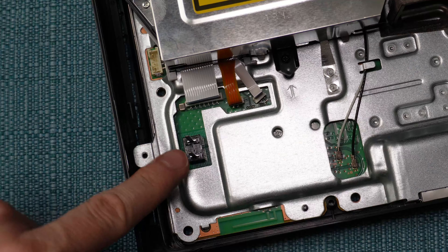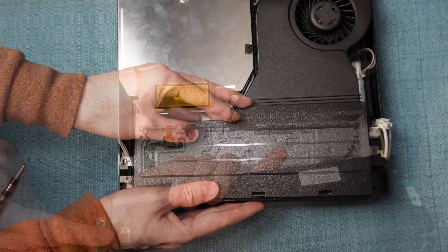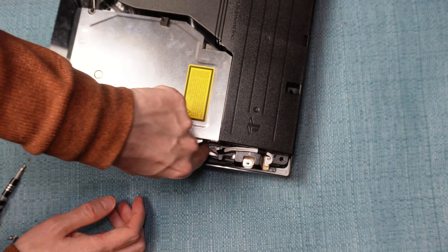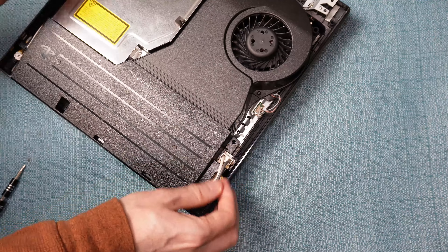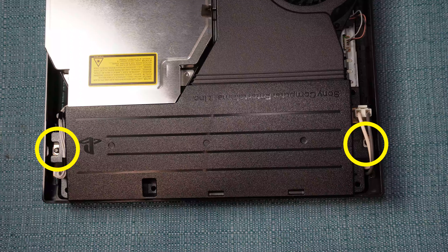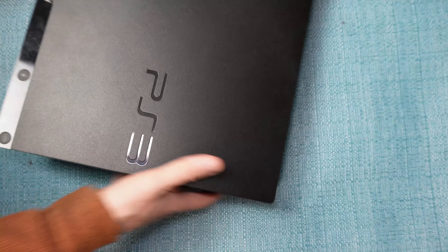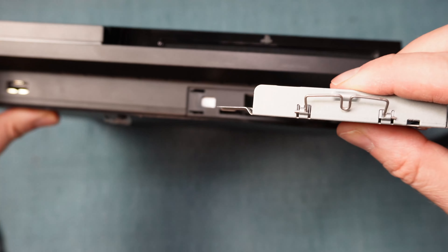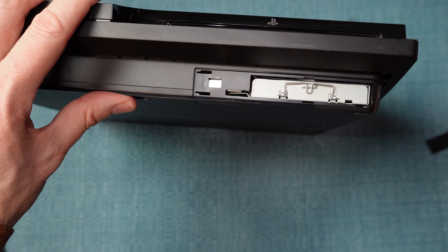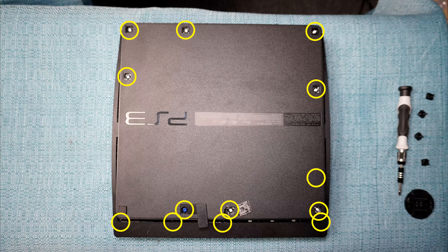Next put the power supply back on. You don't want to bend those pins, so just make sure they're lined up with the two holes. Reconnect the ribbon cable here, then the big one on the other side, and then the small one over here. Screw the two power supply screws back in. Then put the top back on. Put the hard drive back in — notice the way the plastic is cut, the blade of metal slips right into it. Push the handlebars down and slide the cover back on. Then replace all the screws on the back.